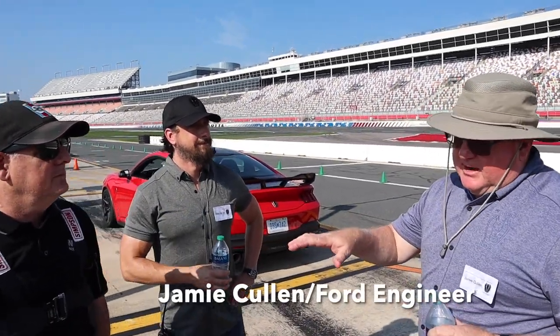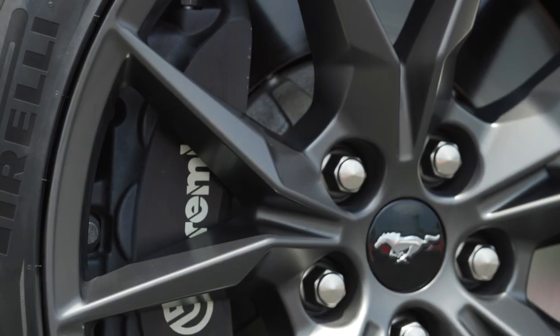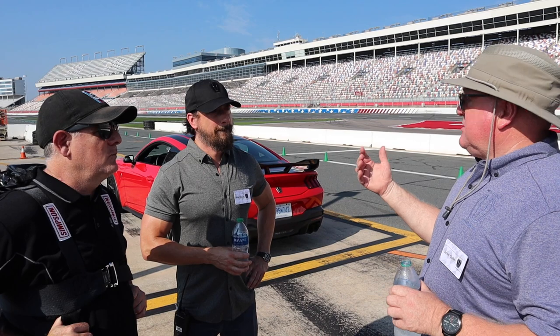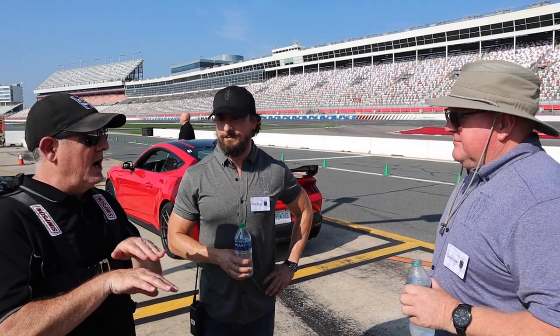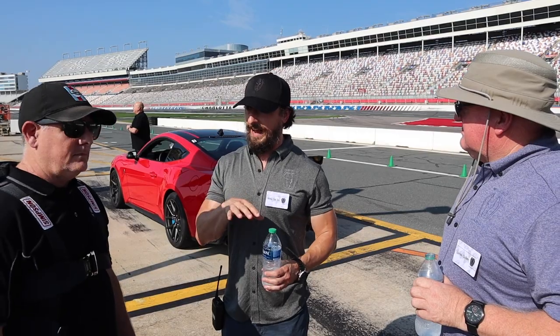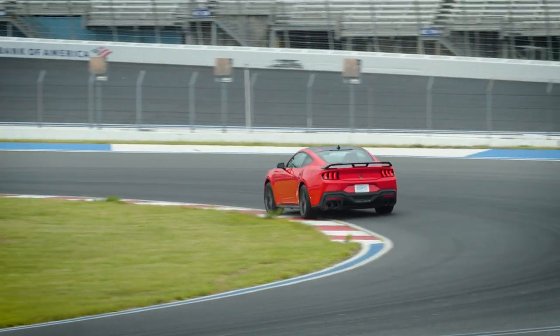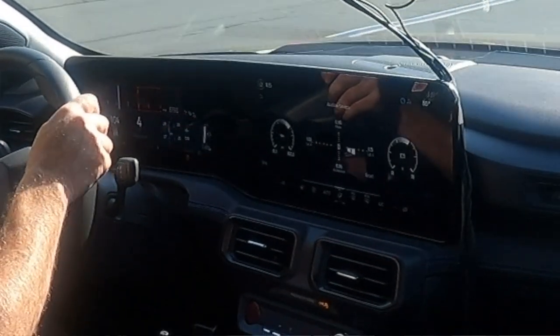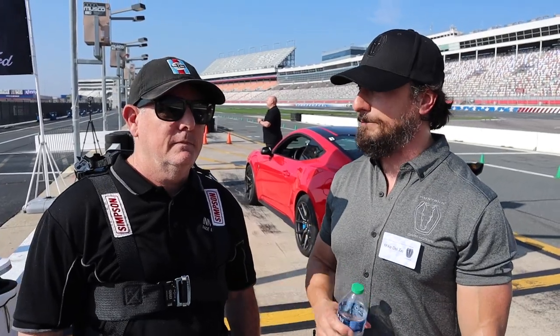The thing you were talking about — getting back to the throttle — that's a function of the Pirellis, right? They've got great lateral grip, but they brought a lot of longitudinal grip to the table. That was one of the things we actually had to learn with this car at this track — holy crap, did we get back to the throttle really early? And I really used the gator strips; I had it hard on the apex and it didn't upset the car at all. We spent a lot of time on MagneRide tuning for that exact thing, adding compliance there. When you're transitioning fast, putting the control back in — I wasn't on throttle the way a NASCAR guy or road racer probably could be, but the car still felt totally under me, totally hooked to the track. The loading in the banking — I don't know how many Gs. Have you got V-Box data from your lab?